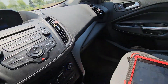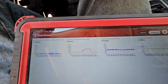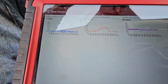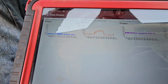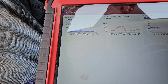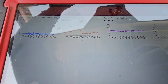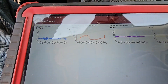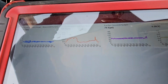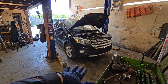I've also got my scan data pulled up here on the fuel rail pressure sensor. After driving it for a second, you can see that our fuel rail pressure is much lower than our desired fuel rail pressure, and we've got a lot of hash in that too. Crankcase pressure seems to be alright. But if we just hammer on it, we don't go anywhere — desired fuel rail pressure spikes, and nothing happens for actual fuel pressure. Desired stays high, actual fuel pressure stays low.